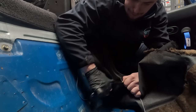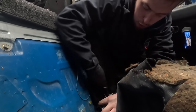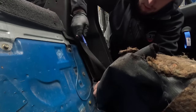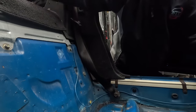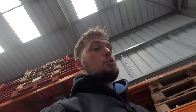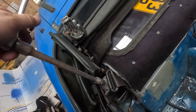Just gotta cut out as much of the interior as we can, cause some things are held in by bolts. I know I'm taking the seatbelts out but it's just so much easier to cut the holes. There we go, we're getting there. There's no turning back now - next we're taking out the steering wheel, the seatbelts, cause we're putting the three-point in, and as much weight out as we can. We're also taking the convertible soft-top out - we're stripping it.